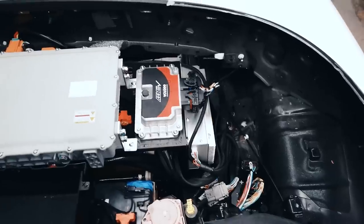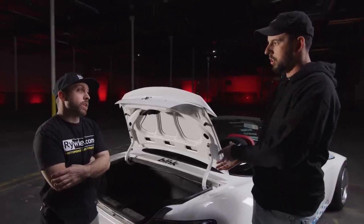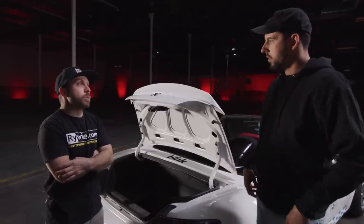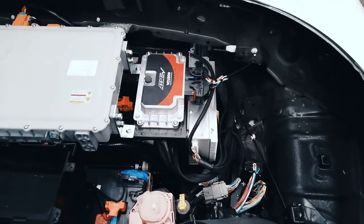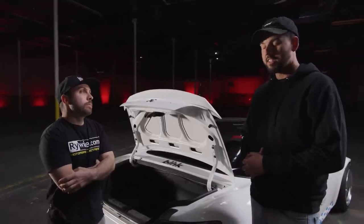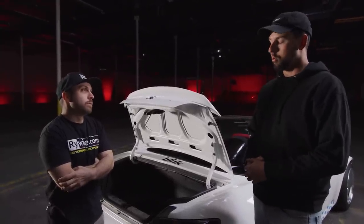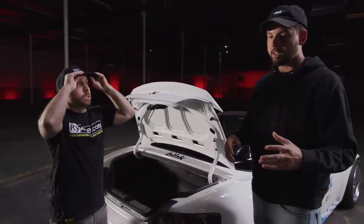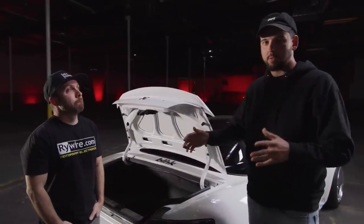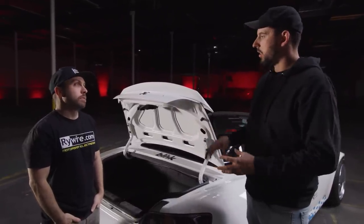This is blowing my mind because it's still tuning — you still have to tune the batteries. And if you've been watching this versus that, the Model S Plaid that we have actually has to condition the battery to get into that optimal zone. It's heating or it's cooling — turning that valve and checking temperatures in multiple places. Somebody had to program that in. So instead of doing timing and boost and fuel maps, you're really doing all of the strategy to make the battery run in the best temperature it can, hot or cold. We're using an AEM VCU to do that. Their VCU is specifically their AEM EV branch. We're seeing standalone ECUs for EVs right now — that's wild. It's the wild west we're in right now of figuring out how to tune all this and make it all work.